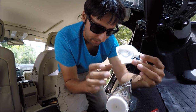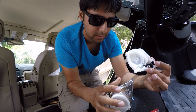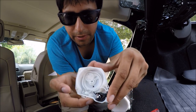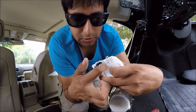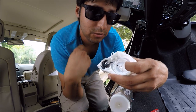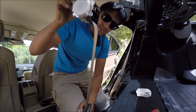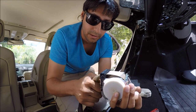I got the module open, and you can hear — no more rattle. What was causing the rattle? There's a metal ball in here that is designed so when the vehicle goes upside down, the metal ball acts like a counterweight and forces this tooth to engage into the seatbelt, preventing the seatbelt from continuously loosening and the passenger hitting the ceiling of the car. Here it is — seatbelt upside down, it's going to engage. But it does not affect the seatbelt in a forward collision.